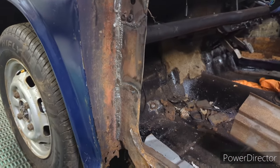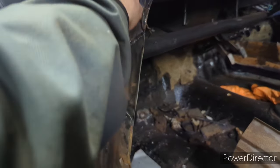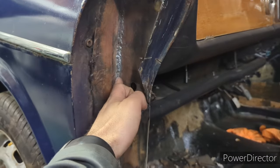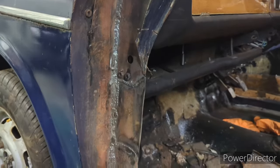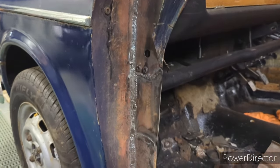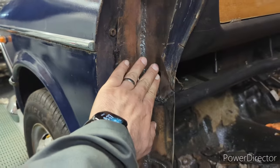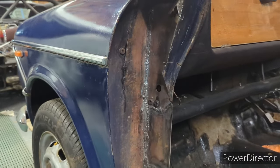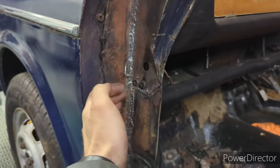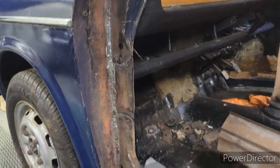It's solid again. The welding went okay on this plate, but in here was absolutely horrible because I couldn't clean in there properly — you've got two dirty, rusty, horrible surfaces. So I just turned the welder up a bit hotter and burnt my way in there. It doesn't really matter what it looks like; the fact is the inner wing is now tied back to the body again, because I don't think they'd bothered. It's supposed to be attached here with the A-post, and it wasn't. Just going to make this car that bit safer.